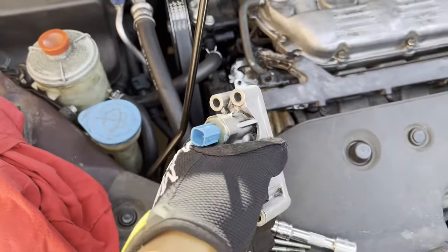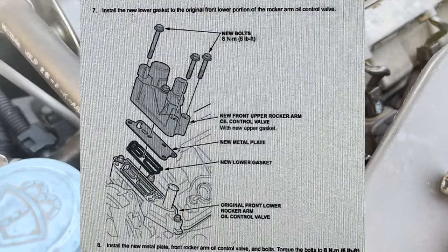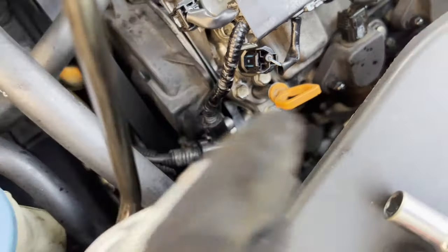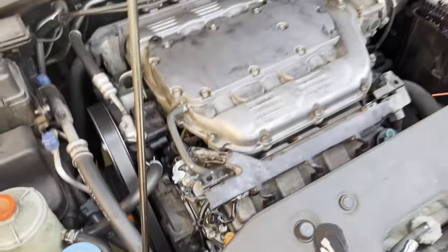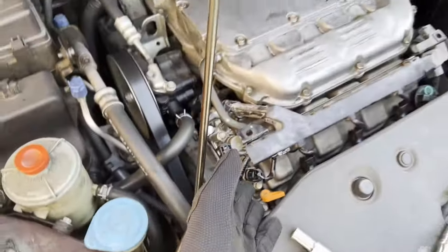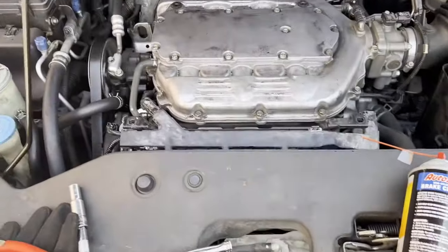Just put it on there flat, make sure it doesn't pinch, and put it on so the seal doesn't fall out. All right, so we're basically done. Just tighten down the two bolts on the bottom and one bolt on the top. As you can see, I cleaned it up really well, have it running, and so far no leaks. Make sure to check your oil before you start it up, because when you take it off some oil comes out — it's not a lot, but always check. That's pretty much how you replace these two seals. It's a very common issue — many people think it's leaking from the dipstick's o-ring, but it's actually that plate and these two gaskets. Thanks for watching and hope this helped!